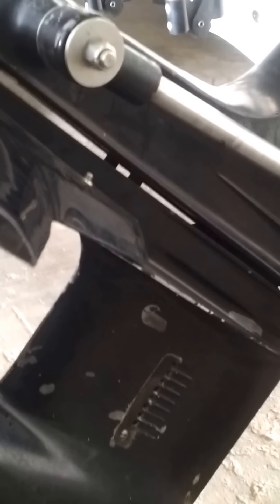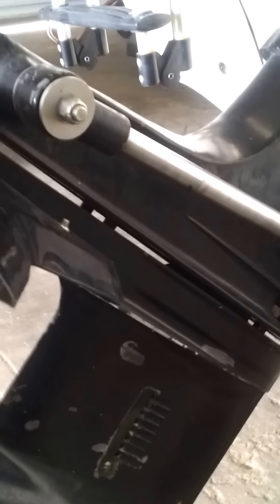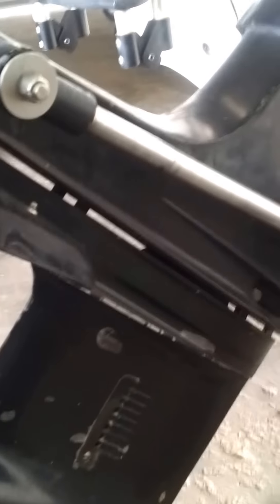I recently found out that these pumps are made out of rubber. Basically it's just a rubber impeller that gets pushed down into a housing, which we'll show you here in a little bit as soon as I get it apart. We'll see what kind of condition it's in — they dry rot and wear out, so I want to replace that water pump for sure, since I have it this far apart.